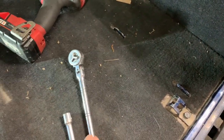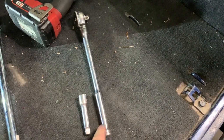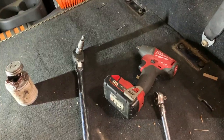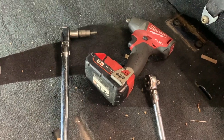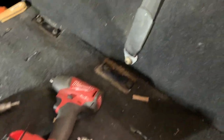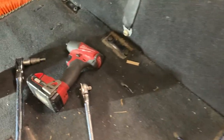What you're going to need for tools: if you're lucky you can get away with a small ratchet, but in my case I get to use a large one because I live in an area where there's salt. You need a T45 Torx — a good quality one, not a cheap one. You've got one bolt right there, another one inside that hole, and one behind there — three bolts total to get it out.